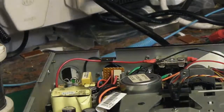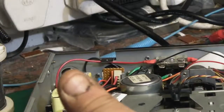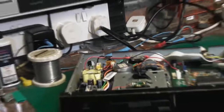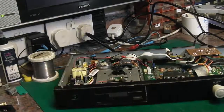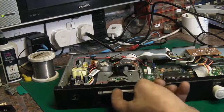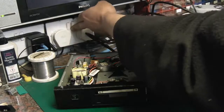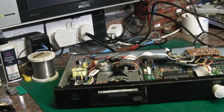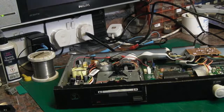That's pretty much it. I haven't actually got it to boot yet — I'm now having issues with the disk drive unfortunately. Let me show you what it's doing. We can actually put a disk in now. So we put that copy of Locoscript in, and if I switch on — it helps if I actually switch it on at the wall. You can see it does actually start the disk drive, but it's not actually trying to read the disk unfortunately.